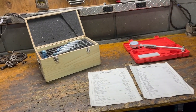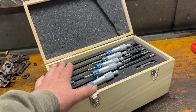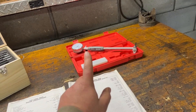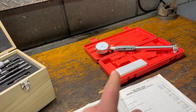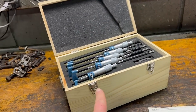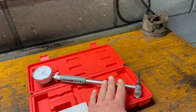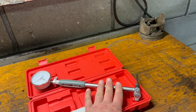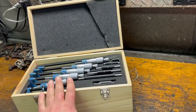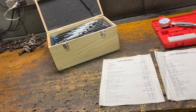So far, that has not been the case. I did buy a relatively inexpensive micrometer set and a probably more inexpensive bore gauge. That will probably be upgraded long before the micrometers will be. But these tools are allowing us to test the dimension of the cylinders in the block and mic them out. We can also use these micrometers to test the outside dimension of the crank journals, both the main and the rods.